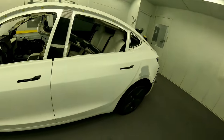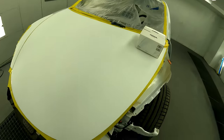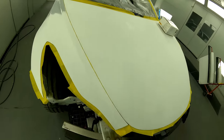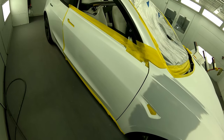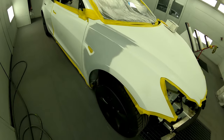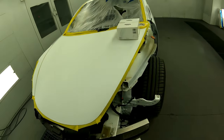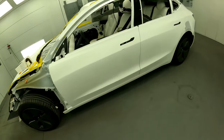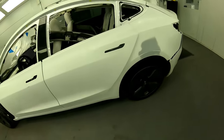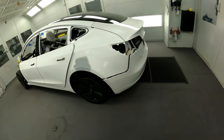This is a pretty big job and I've already masked up the right side of this vehicle because I don't have to get back in that side. So this side's already masked up and ready for the bag, but the other side I had to open the doors to get in it because the headliner's loose on this one. We definitely wanted to get it in here before we mask up this side, so let's go ahead and mask it up. I'll show you how I do the jams normally and then we'll try the foam out.